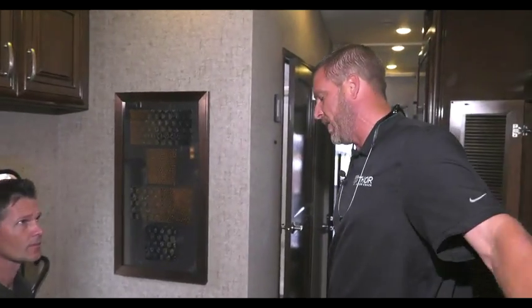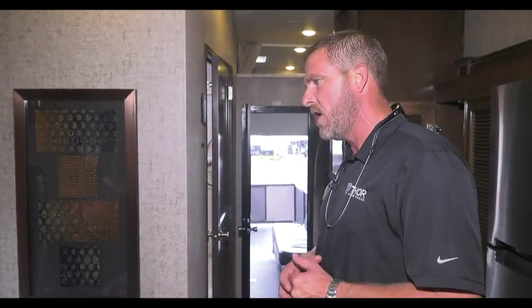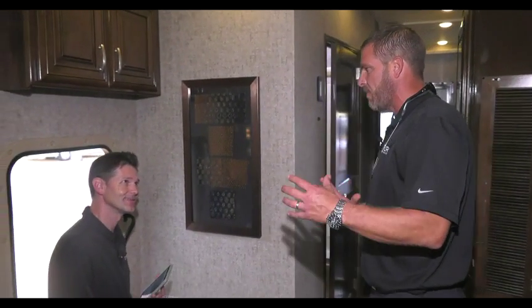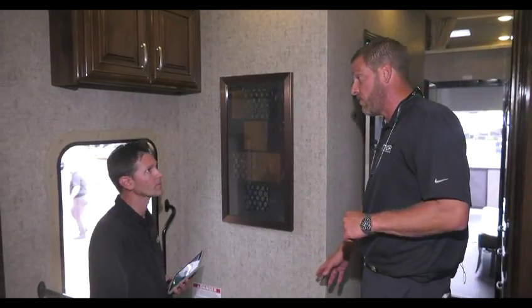This coach has four batteries. I've got clients out there getting a lot of different ranges. We like to quote 6 to 8 hours. With four batteries, you're going to get more than that, but it depends on how many lights you've got on. You have to compromise, but you can set that on your auto gen start for time, temperature, and voltage.